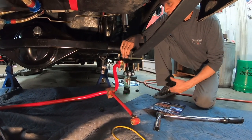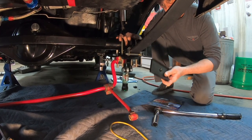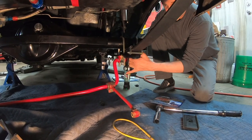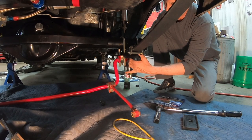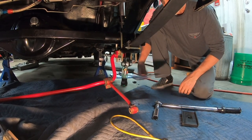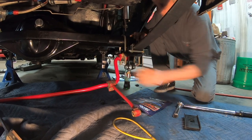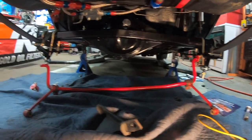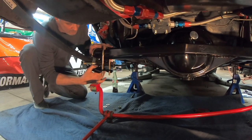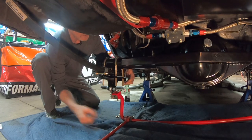Now that the rear end is up and located on the leaf springs on the little dowel pins, it's solid. There are no spring pads like in a passenger car — this is metal to metal on top and bottom. The hole in the bottom of the cal tracks is a little larger than the dowel pin, so just center it and when you tighten down make sure they're straight and run up about even. According to the directions, torque them between 65 and 70 foot-pounds — I torqued to 65. Then I put the sway bar on this side, putting the sway bar bushing on the bar and lining it up before bringing it up and doing the bolts.